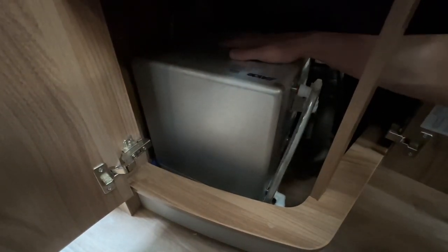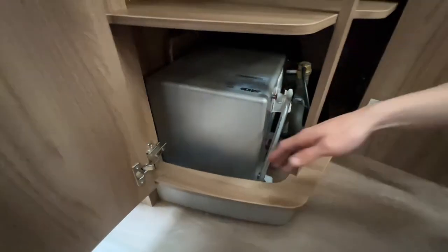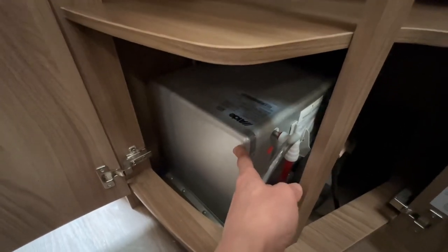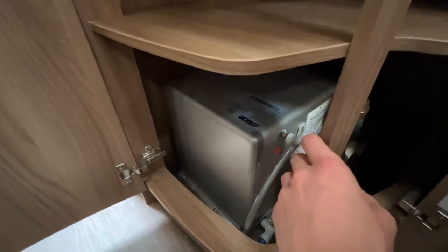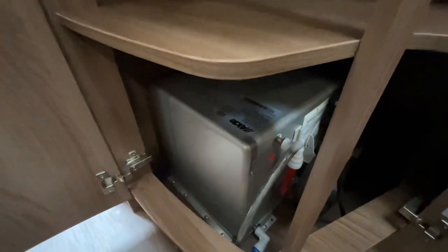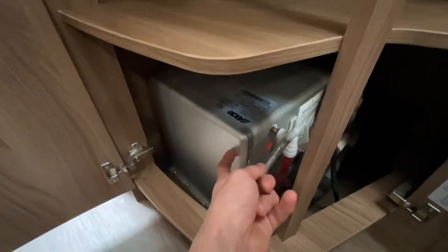It's very important that you drain the boiler down. To drain the boiler down, there's a little toggle just here, directly underneath. It's a yellow toggle — just flick it up and stand it on end and that'll drain off all 10 litres of water in the boiler. You do that in the winter to avoid it from freezing. From back end of October to March/April time, you need to have the vehicle drained down when not in use. It stops the water from freezing here.